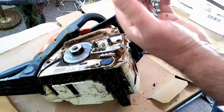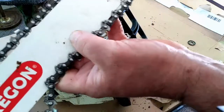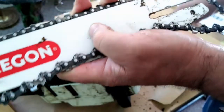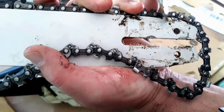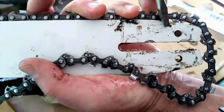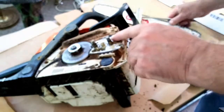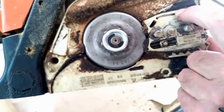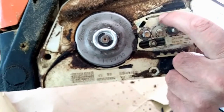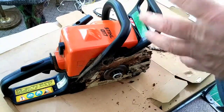One more important part of how it operates: on your chain bar, above the two tightening holes, there's a small hole right here — this is where your oil feeds in and lubricates the chain. That hole coincides with this groove, so as your bar is adjusted, that hole will always be over this groove, and oil pumps in. That's how it gets to your chain.